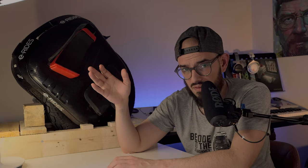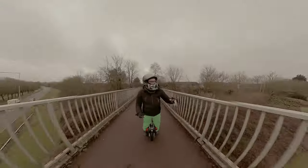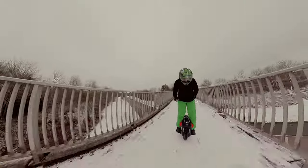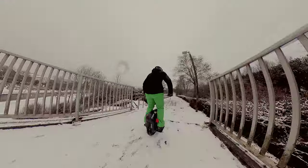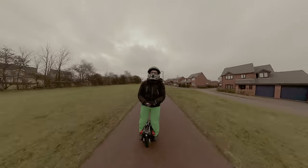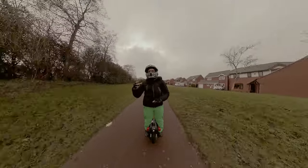People don't really understand this motor. Yes, it's the biggest motor on the market, but because the wheel is 39 kilos, it takes longer to get going than something like the EX N. It's like a 90-kilo football player vs a 50-kilo one — more muscle doesn't always mean faster acceleration. But once you reach that speed plateau, the motor just keeps going and doesn't want to stop.